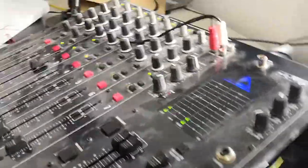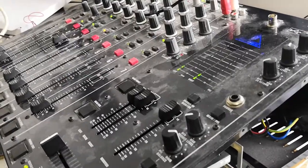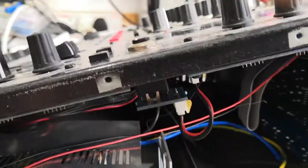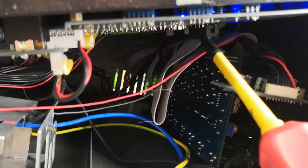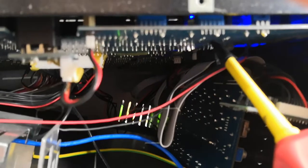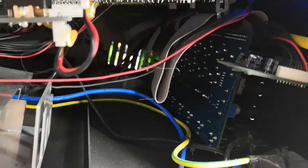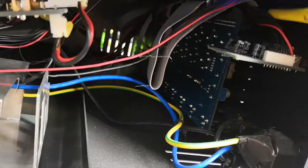Your problem is actually right at the very last stage. If you're finding that you're getting audio coming okay from the headphones but not from the main out, this implies that the problem is beyond where the headphone output is, which is this little thing here. It was pretty easy to trace the problem right to the output amplifier. If you look into the mixer, you can see there's a ribbon cable here connecting the mixing board to the output board, and this ribbon cable is often the source of your problems. Follow it down to where it inserts into the amplifier board, and if we play with this, you will be able to hear the audio cutting in and out.